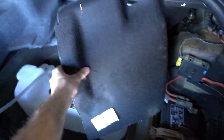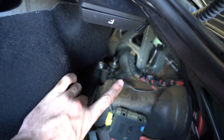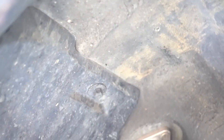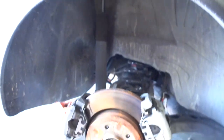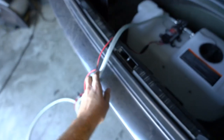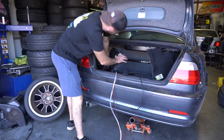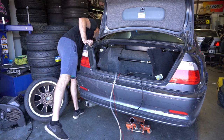Starting in the back, we peeled up all the little carpets and located where we want the mist hose to plumb and route through to the wheel well. Behind this wire loom we went underneath and drilled a test hole right here, which puts the mist right in the center of the tire when the tire is on. I'm going to step that drill bit up to the same diameter as our hose, stick the hose through, then put the mist tip on — one on each side — and tee those two into the one main hose coming from the pump.